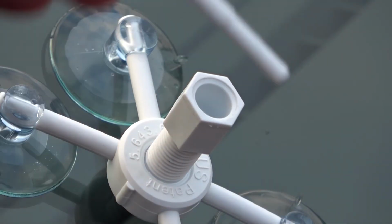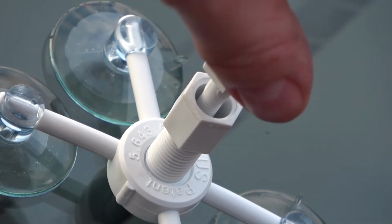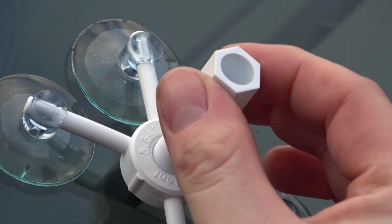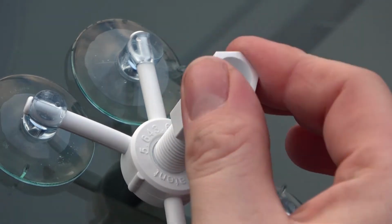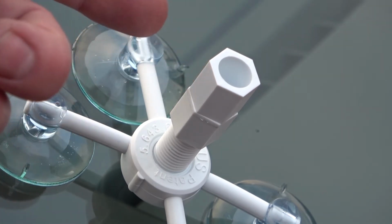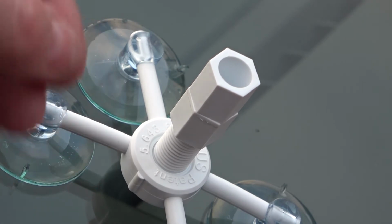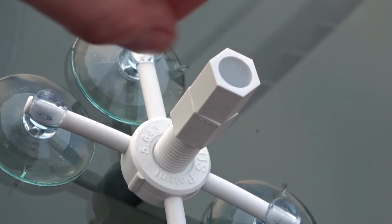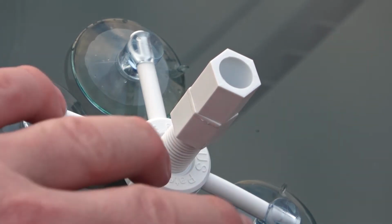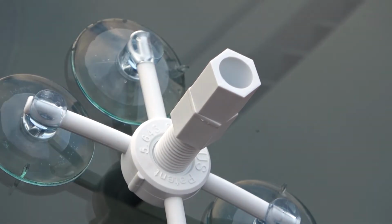And here is the plunger. Now it says to screw this down and wait for about 5 minutes. So now that's tight into the actual chamber itself, you have to wait 5 to 6 minutes for the resin to do its thing and permeate into the actual crack. So I'm going to wait 5 minutes and then you back this off and put it back in, and then you can actually remove this actual base and see if the crack's been filled.